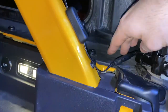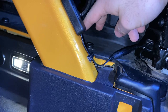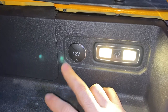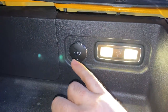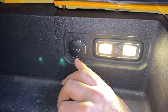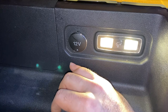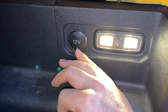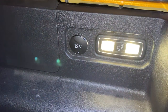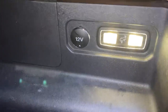From this sensor I have another wire end that just has two black and red wires coming off it, and from there I tied it into the cigarette lighter. If you take this panel off, you can get to the connector for the cigarette lighter and tie into those — it's only got two wires, a positive and a negative. The only downside to doing it this way is that after an hour your lights will cut off after the truck has been off. But if you want them to come back on, all you have to do is hit the key and they'll come back on for another hour.